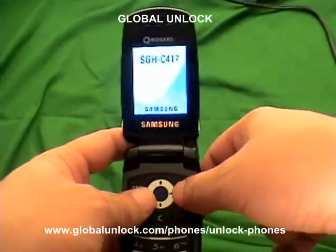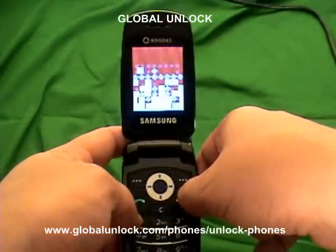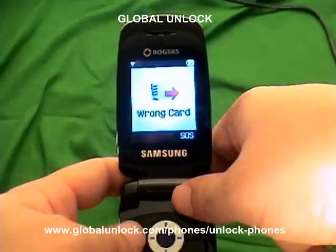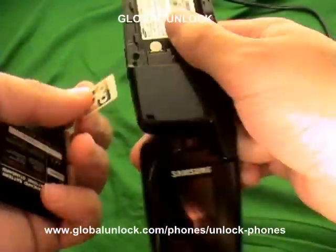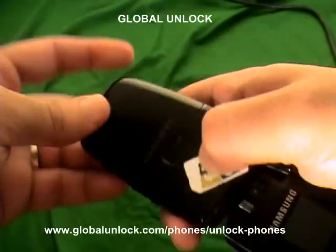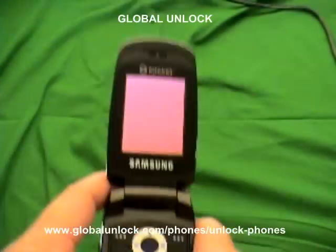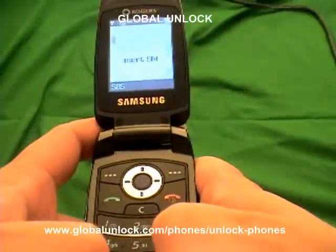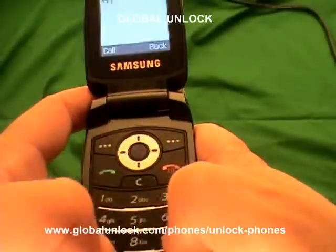While it's powering on, if you don't have your unlock code, you can go to www.globalunlock.com or the link in the comment section to get that unlock code for this phone. Let's see what happens — Fido SIM card in here, and it says 'wrong network.' Now let me show you the process on exactly how to get rid of that. First, take the SIM card out of the phone — there's no SIM card in the phone when we do this process. This code is unique to this phone, so don't try another code not made for your phone because you can damage it or hard lock it, which means you've put the wrong code in and you can't unlock your phone.